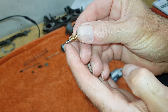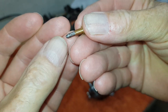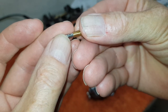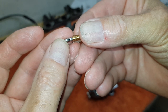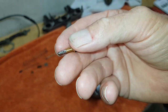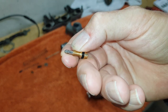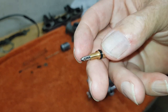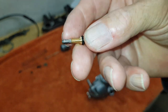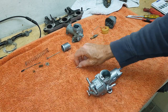I've just checked and the fact that it's got three rings on it - can you see there are three grooves? That means this is a size 19 pilot jet. One groove means it's 15, two is 17, and three is 19. I'm surprised at that because last time I spoke to Amal they said they were fitting 17s. I've got 19s on my T160 but they told me they tried 19s but were fitting 17s as standard, so I'm waiting for clarification. But the key thing is you can change the size of your pilot jet dead easy by simply unscrewing and replacing it.